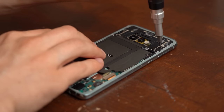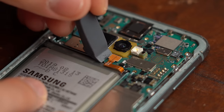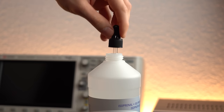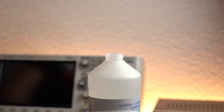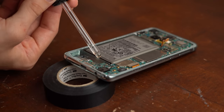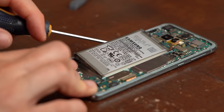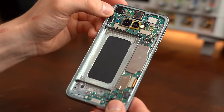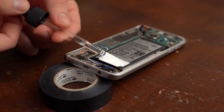Moving on, after removing the coil cover again I unplugged the battery from the phone. To get it completely out I filled a pipette with isopropanol and slowly dripped it behind the battery so the adhesive could soften, allowing me to successfully lift everything out. That worked out almost perfectly, perhaps because I had practiced this before with my busted S7.